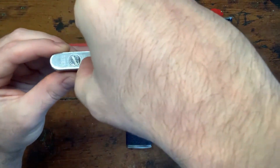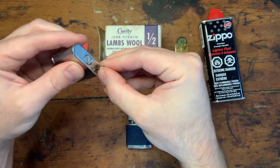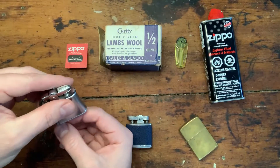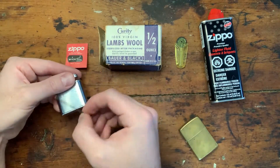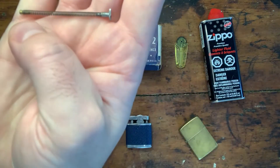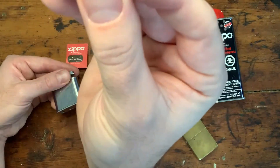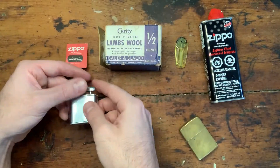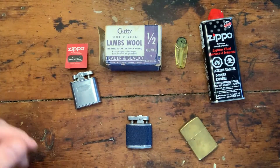You can hear that twist - it's almost like winding a clock. Go very slowly, keep some pressure on it because it's going to push out on you, and now you see the spring coming out. Put it upside down and slowly take out the spring. Now something to notice - my flint is still stuck inside. When you look at your spring, at the end is a plunger. That is not your flint. That is purely the plunger for the flint so the flint doesn't go sliding through your spring. Save that, be very careful, then turn your lighter upside down and what should pop out is your flint.